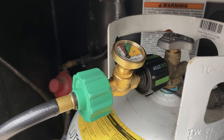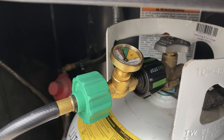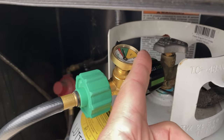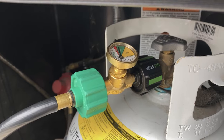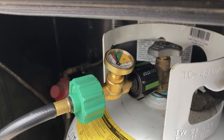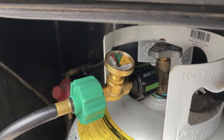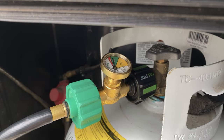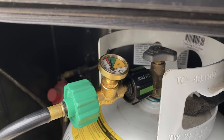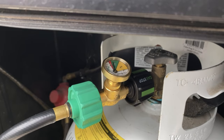Five minutes are up — and good news. The needle on the Gas Stop gauge is in the same spot, meaning we have no decay in our system. We shut the propane off at the bottle, all appliances that would draw on propane inside the coach have been shut off or switched over to AC power. All the propane in that system was trapped with nowhere to go unless there was a leak — and the fact that the needle is in the same spot is a great indication that, thankfully, we have no gas leak.